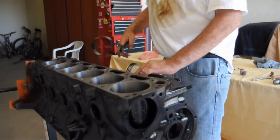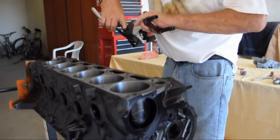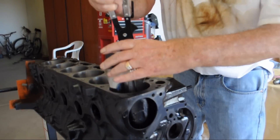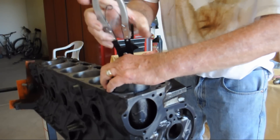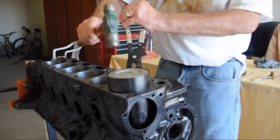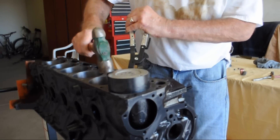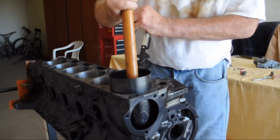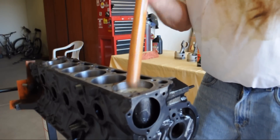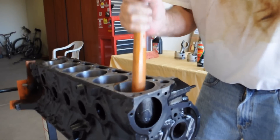What I've done now is put copious amounts of oil all over the piston and rings and wrist pin and everything. With the ring compressor on, set it down in the cylinder, get the ring compressor down until it's level with the block, then smack away. You don't need to worry about it hitting the crank — that's where you've got the wipers on. Done.